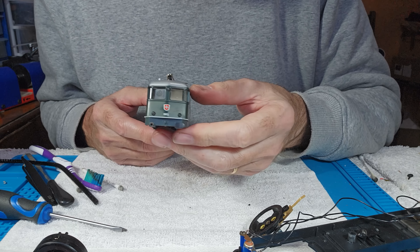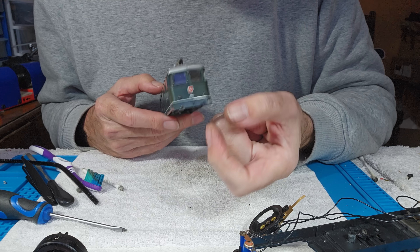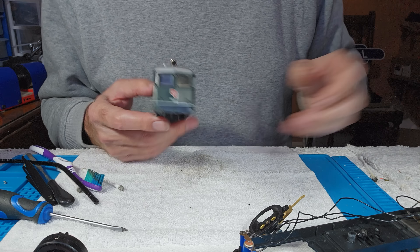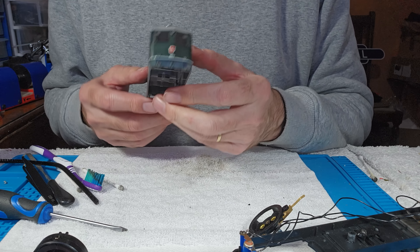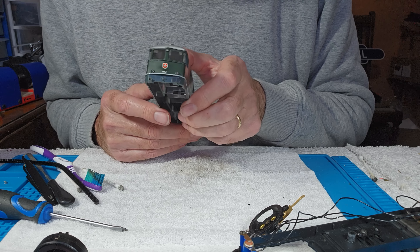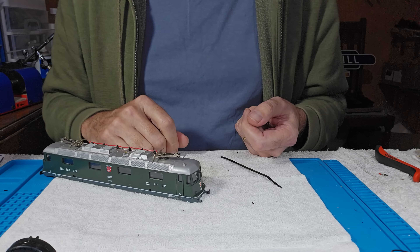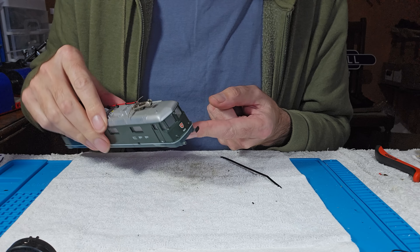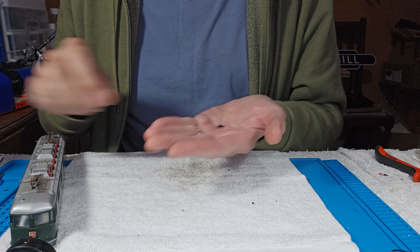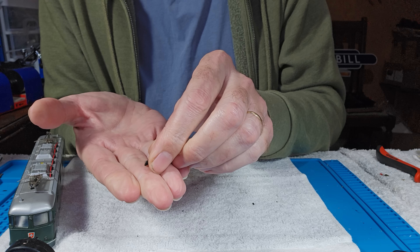I'm going to go online and see if I can get a replacement buffer for this. As you can see, they're quite an odd shape — they're flat on one end, kind of oval on the other, but quite elongated. The closest I've got is an oval buffer, but it's not the same at all. I wouldn't be surprised if I can't get these exact ones, but maybe something close. If not, I'll need to see if I can maybe make something from a big cable tie or something — might be able to make a buffer that looks the same. It's nearly beer o'clock, so I think I'll be coming back to this tomorrow. Okay, so next day — I went online and had a good look to see if I could find a replacement buffer, but I couldn't find one. So I took a bit of cable tie, snipped a bit off, sanded it into shape, and stuck on the stem from another buffer. And I have made a little buffer — it seems to match the one that's already there pretty well.